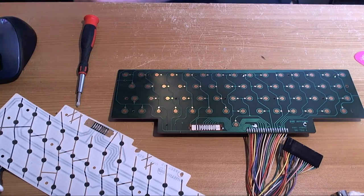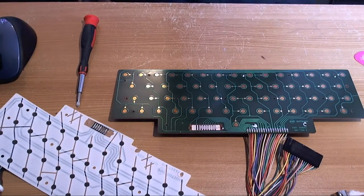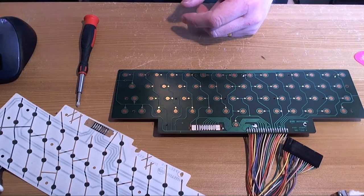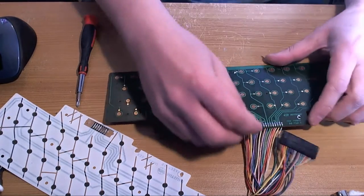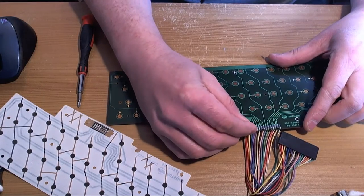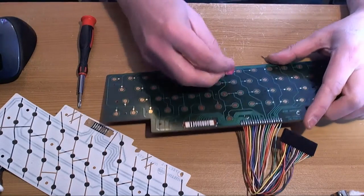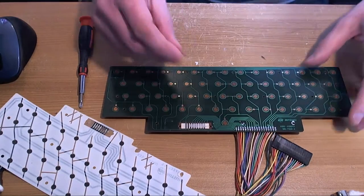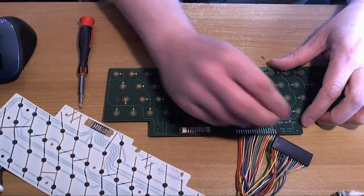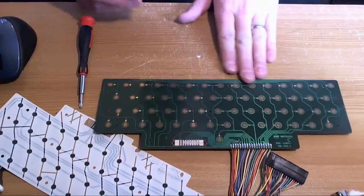And I can't remember which one it was now, because they all look the same. A little bit of flux on there. Not only was there the Uno cart that didn't work, which was embarrassing, but what I did with that Uno cart the next day off stream was remove the MCU completely and reattach it, and that fixed it. I don't know what was wrong with it. I think when I looked closely at it, the alignment was just a little bit off. It looked good enough to the naked eye, but there must have been a short that you just couldn't see, even with high resolution photos.